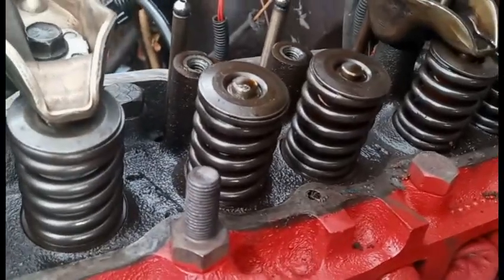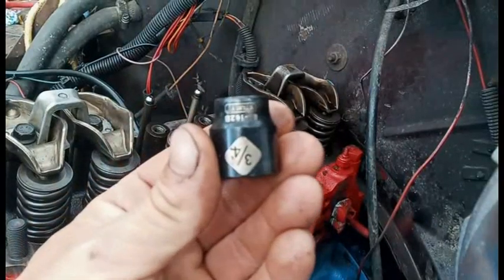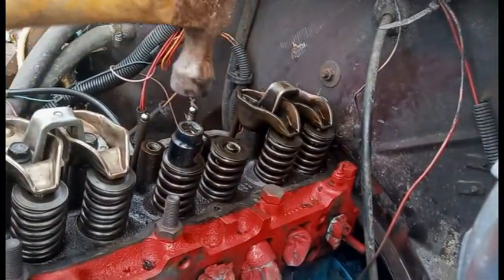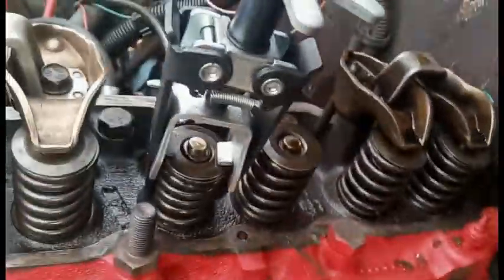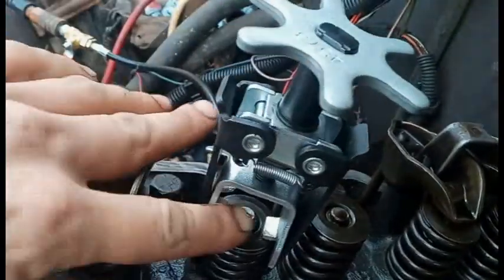Let's bring the presser on there. Once I turn on the air compressor it will get much louder. I took a three-quarter socket, placed it on top of there, then tapped it several times with the hammer to first break it loose. Now I've got the spring compression tool on, about halfway compressed.